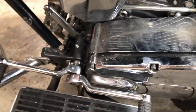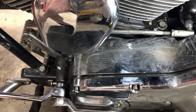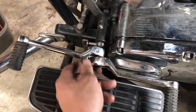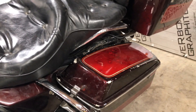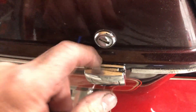When I'm driving, there are a lot of rattles on this bike I'm trying to clean up. A couple of them are the latches on the saddlebags — that's why they went away from these bags with these latches, because the latches always vibrate and come loose. There's also too much free play in here so I'm going to take that free play out and put some grease in there to soften it up. One latch here doesn't quite go tight — it rattles when you're driving. Just trying to get all the rattles out of it.